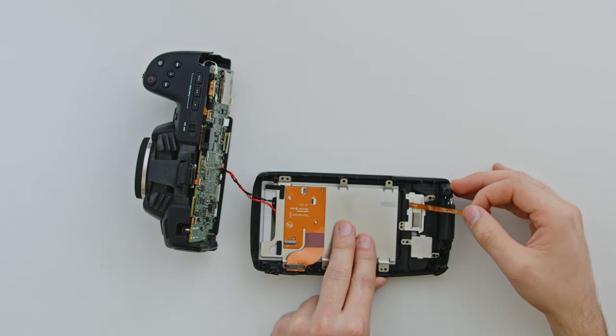The last few steps are the same for both cameras. Insert the small white rubber diffuser for the tally light, then stick the transparent tally light window on. Add the same sticky panel at the bottom right to cover that bolt hole, and then add the rubber grip back on, starting from this edge and wrapping it around. The final step for both camera models is to add the last parts to the base of the camera. There are four small silver bolts in your second container which need to screw into these four holes using the small Phillips screwdriver. Insert the black metal cover into this space and use the final four black bolts to reinstall it using the T6 Torx Allen key. Finally, you can add the original Blackmagic sticker onto the base of the camera, though this isn't essential as some do lose their stickiness.